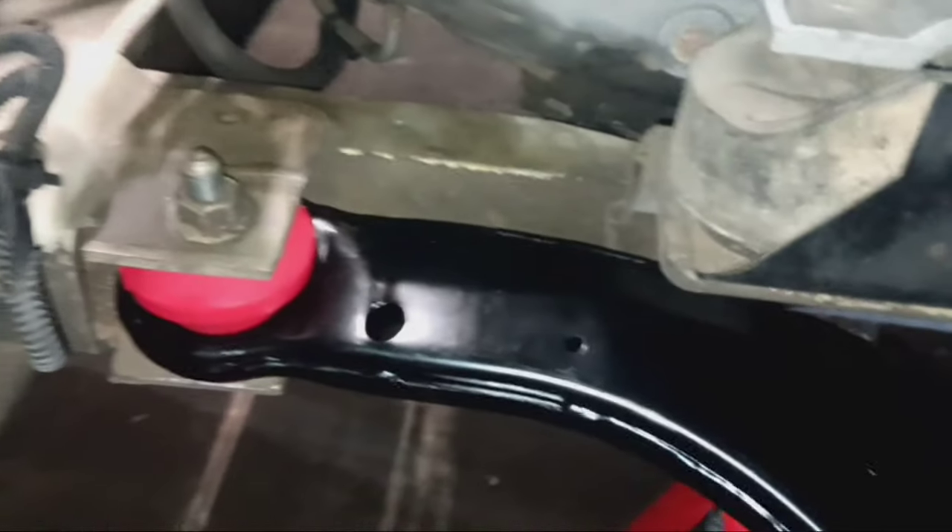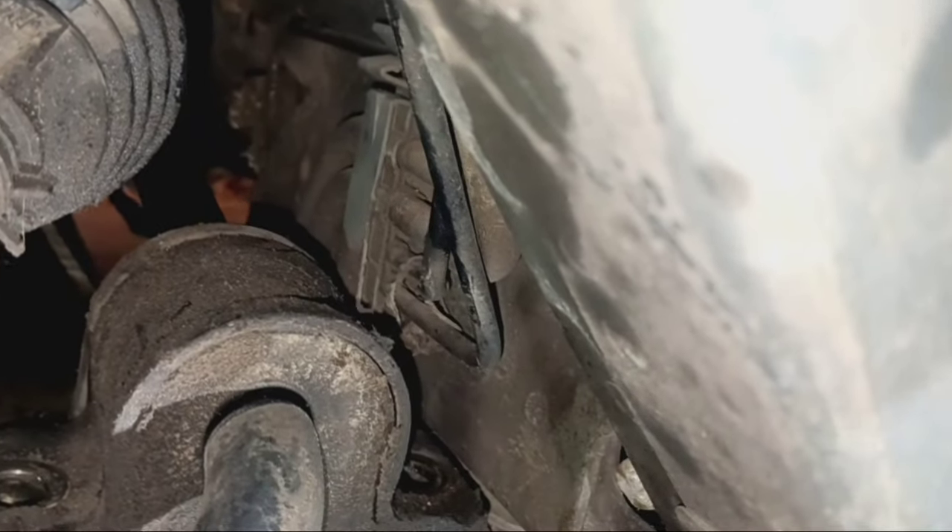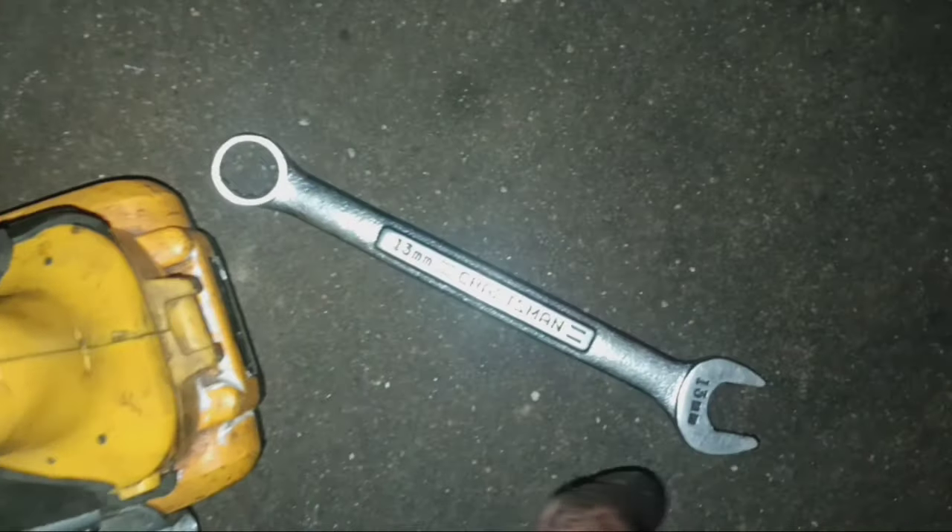It's starting to get a little windy and a cold front came in, so I threw a hoodie on and a beanie and I'm still going at it. I've got this side all back together — everything's on, cotter pin is in. I've got the two sway bar bushing bolts removed so now it's loose on this side. I used a shallow 13mm socket with a skinny ratchet and had to use an extension in the back corner because the brake line was in the way, and also a 13mm wrench.